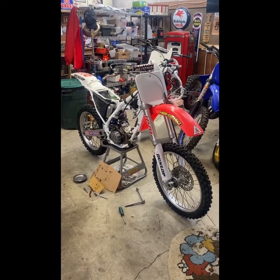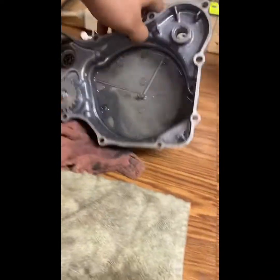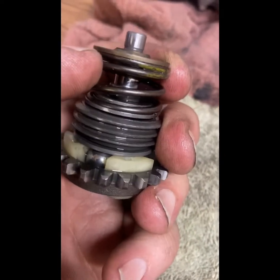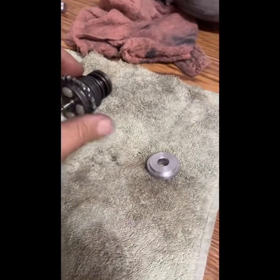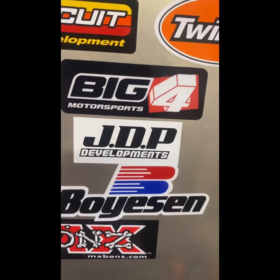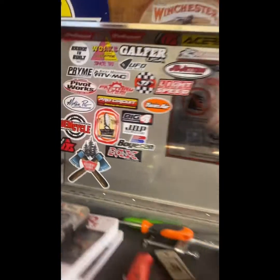We've got the governor out of the bike — it's right behind the outer clutch cover. What we're going to do in this video is take the top cap off of this governor, that's right above that spring there, and replace it with this three millimeter spacer. Apparently that will make the power valve on this bike open up sooner and get rid of that flat spot. I went to Harbor Freight and got a gear puller — I did have to grind the hooks down in order to get it underneath that cap, so just be mindful of that. If you want to get one of these spacers, look up JDP Developments out of England on Facebook — I'll put a link in the description.